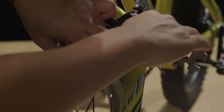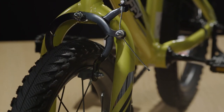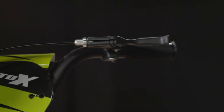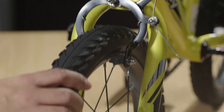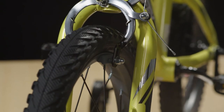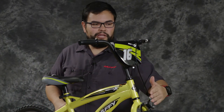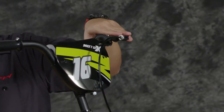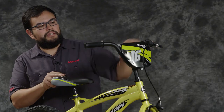This doesn't have to be super tight — if you get it too tight you may damage the cable on the inside. After that, actuate the lever to make sure the brakes work. It looks like we have brakes working on both sides. To test that, spin the wheel and give it a squeeze. With the brake lever finally installed and the brake cable in place, make sure this lever is adjusted properly — typically between 30 and 45 degrees angled down is where you want it so that the person using the brakes is able to grab it appropriately.